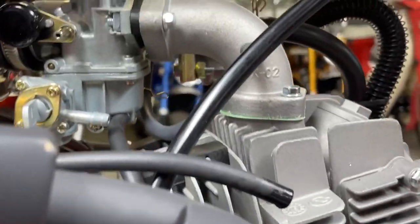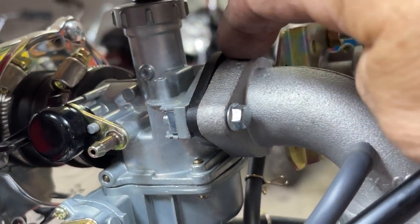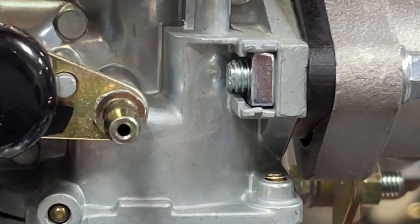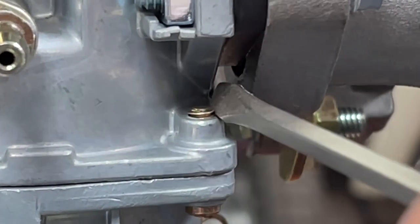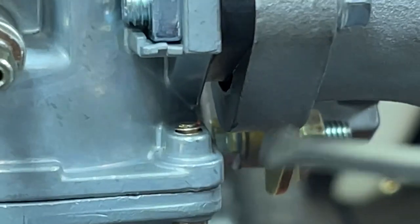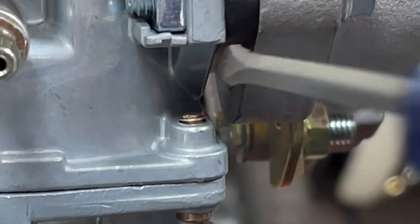I was draining the fuel out of the reserve line into my jar as I was sitting here. Look what I see. See how that insulator is way up above the intake? I turned and I looked. Am I seeing an open intake? I've got to get my light in there. Am I just sucking air straight into the intake right there? Is that why it won't run, but anything on choke? Because it's already sucking so much air? I think so.